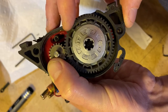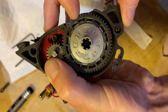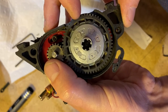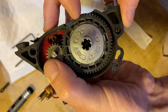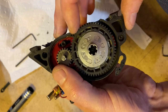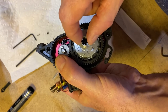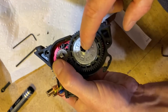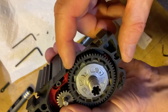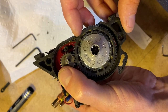Once you get this, rotate it to various locations because these are not manufactured perfectly - as you spin it, things are always going to be slightly different shapes and sizes and you're going to get different meshes. You're looking for the farthest end point that hopefully hasn't wedged itself. On a system where you haven't fully assembled, I'd always default to letting it be a little looser than perfect, because putting the cover on affects how the spur gear sits when its bearing comes on, and seating this spur gear onto the input gear of the differential also affects it.